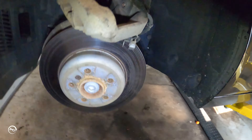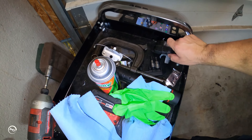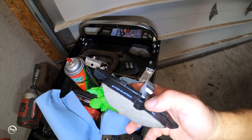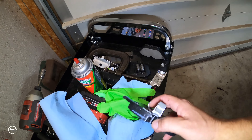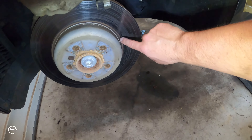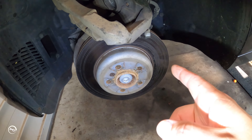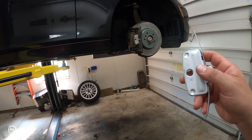On this side you have the brake pad wear sensor that clips onto the brake pad — it's super simple, but make sure you don't forget about it. It slipped right back in there like the old one. I got this side apart, I'm going to get the rotor changed out — you can see how bad this one is. Once that's done and the side is back together, I'll tackle the axles. Front brakes are done — well, I have to go put the retainer in real quick on the other side. I always forget those.